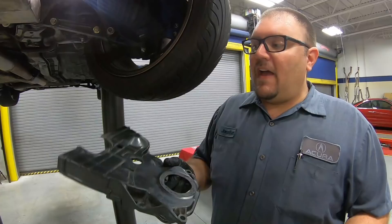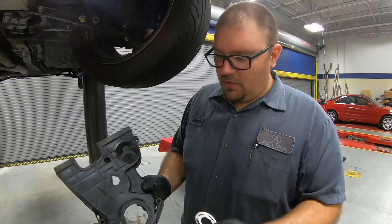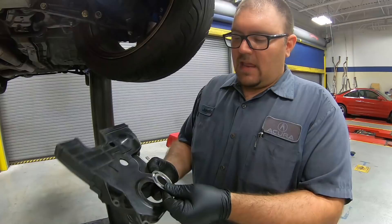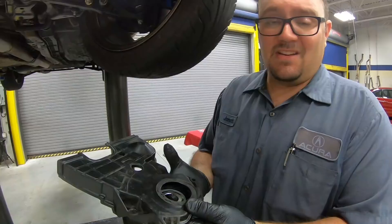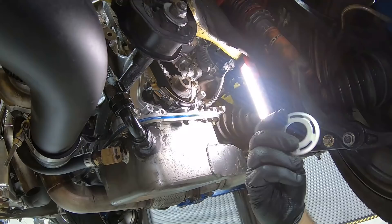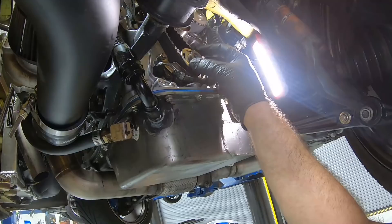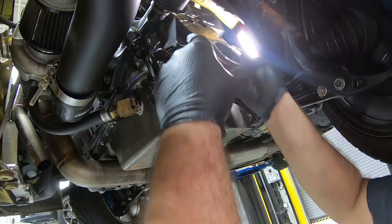It's time for the cover. We found that with that race spec dampener it's going to rub on the cover, so we decided not to put the new cover on and destroy it — we just ground this down a little bit more to give us enough clearance. Nine out of ten times when you do a B-series timing belt, you want to put this washer on with the beveled smooth side facing towards the timing belt. This car came in with it backwards, which made the sharp edge cut the belt. Now this goes on here and our cover is going to go right on over it.